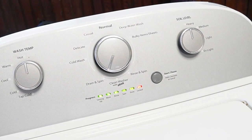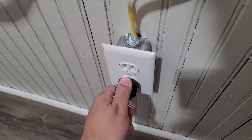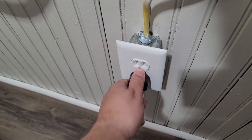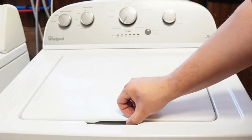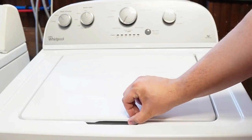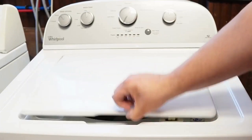When the calibration mode is at the end, every single light is going to turn off, including the lid lock light, and the machine is now ready and recalibrated for use at an optimal level. Now let's try one more reset technique. First, unplug the washing machine and let it sit for about one minute to drain any capacitors or memory, just like we did the first time. Then plug the washing machine back in, let it sit for a few moments, then open and close the lid six times in under 12 seconds. This works on some but not all models and it will issue a reset command to the washing machine to clear any issues beyond what the reboot or reset mode did.